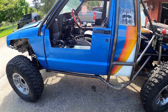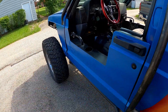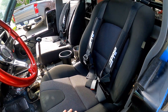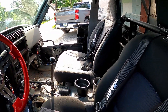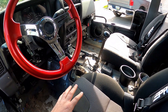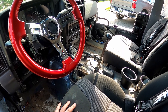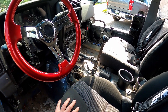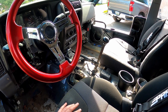I did the half doors — these haven't seen any trail time yet. Interior has an eBay steering wheel, I think a Mazda seat, and the stock XJ seat still on the other side. You see this crazy shifter — I made it an NP435 transmission out of a late-70s Ford. I wanted that transmission specifically because I wanted that granny low first gear to just be able to crawl up stuff. I bought that thing with a transfer case for like $200.